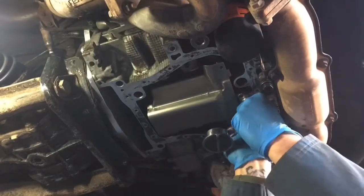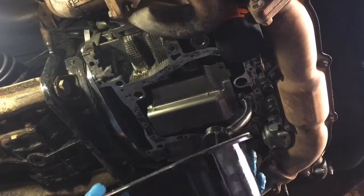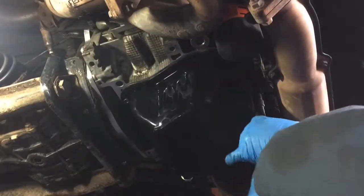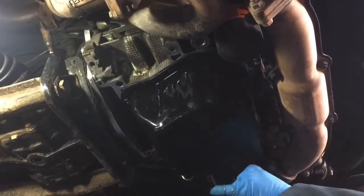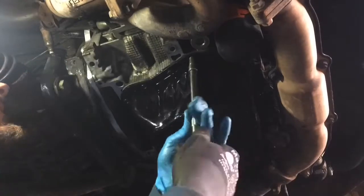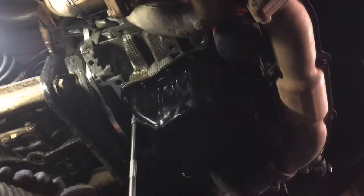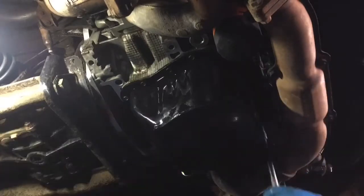Putting the modified oil pickup in. Notice the little bar on the screen of it — that's so that if you do dent the oil pan on the bottom, it won't starve. I put a cork gasket in; I like using the cork, I just find it a lot better than using any sort of goop.